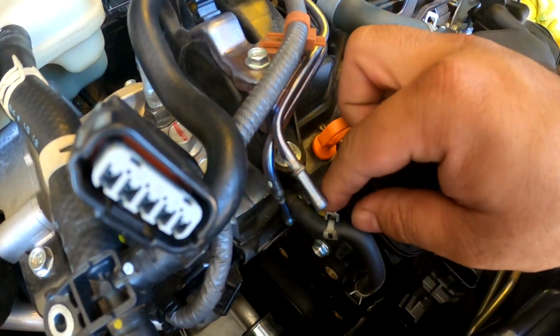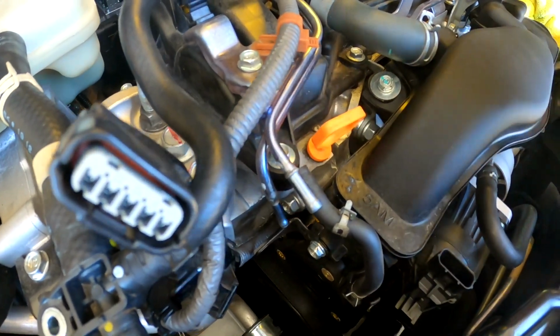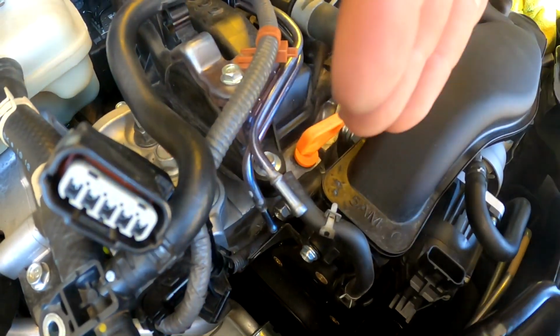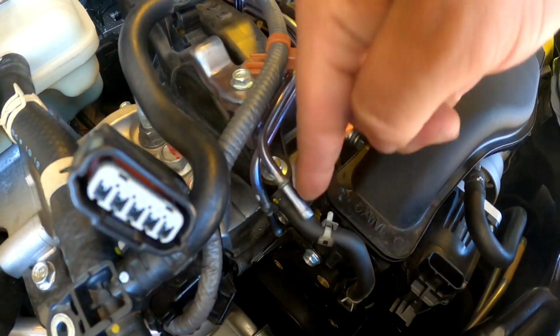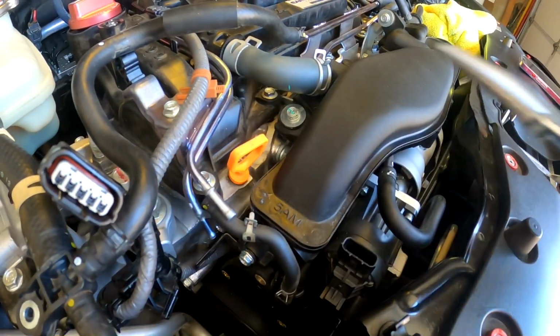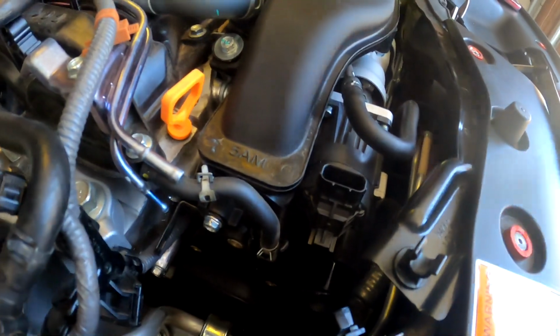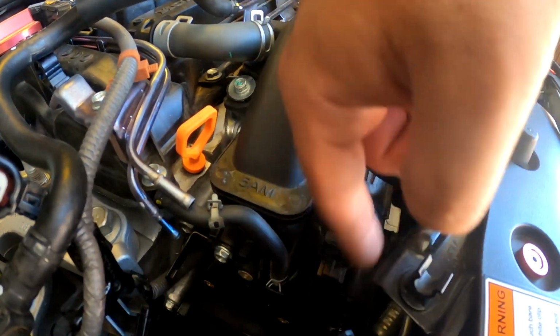Basically, what everybody says is you should bend them a little that way so that they won't hit the tube, because the tube literally curves straight down right here now, and these are gonna hit it. So just bend them back that way. Take some pliers, not like this, but some stronger ones, and bend them that way. That's pretty easy though. So let me try to tackle the bottom ones, all 4 screws.